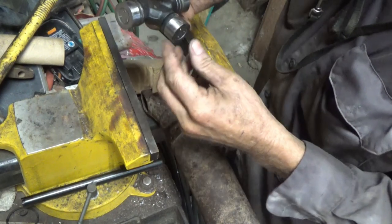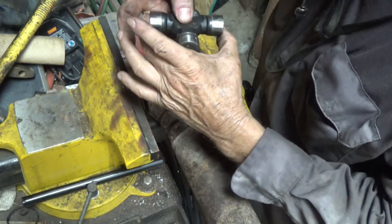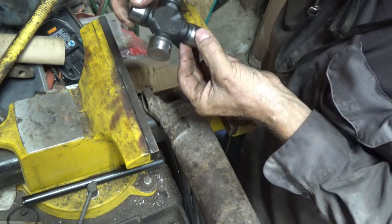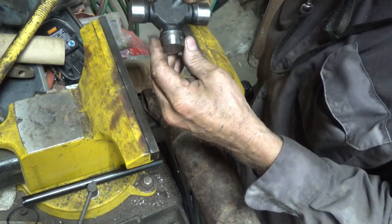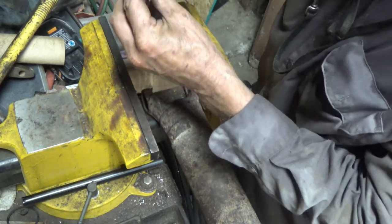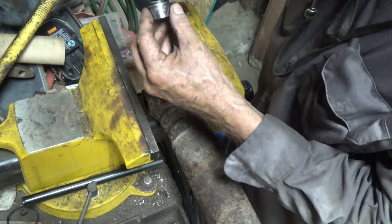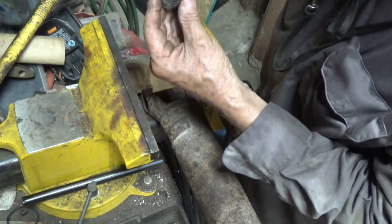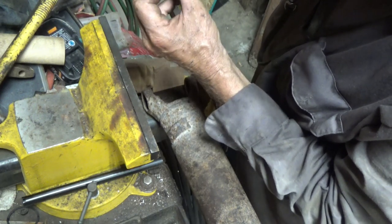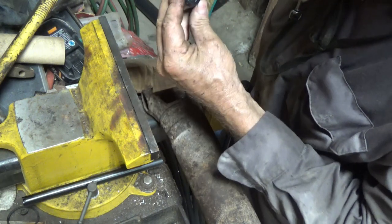Here's a new one. This one is the same on all four sides; sometimes they're not — sometimes one side has bigger caps and the other two would be smaller caps. These are called caps. Another thing: people will drop these and lose the bearings, then put them back together and return them with a bearing missing. You need to look inside and make sure all those needles are in there on all of these.